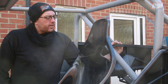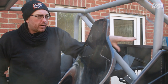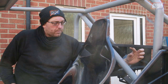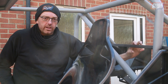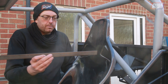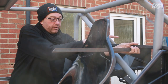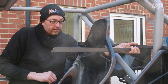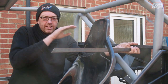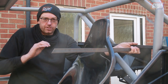I've pulled the seat all the way forward and put a bar in here to represent the top edge of where the harness bar is. This isn't exactly where it would be, but the harness bar would be 46mm — or 44.5mm — below that, so the center point would actually be about 20mm lower than the bottom of this bar, and that's roughly where the harness would attach. Using a piece of inch bar through here, if we go level off the bottom of this box section, the bottom edge of that bar becomes the centerline of the harness bar and roughly aligns the harnesses coming through this hole — which works for where Chris's shoulders are, which is good news.